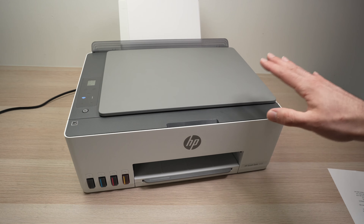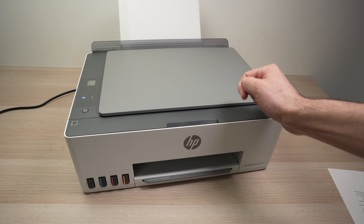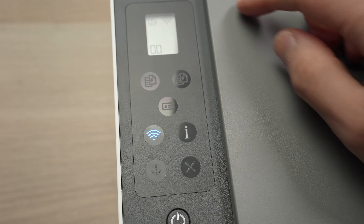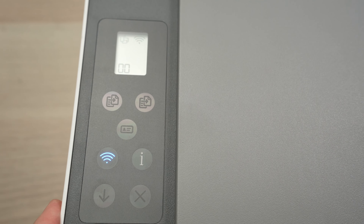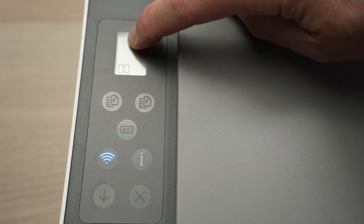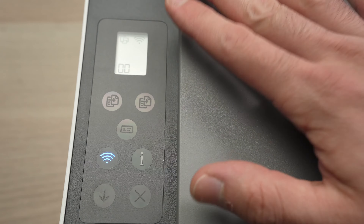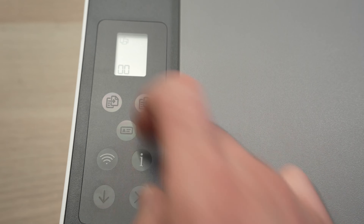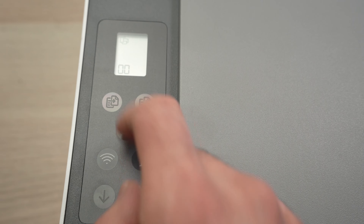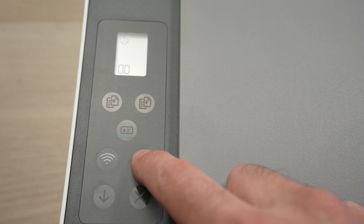You won't need any Wi-Fi router or Wi-Fi network to get this done. The first step is to turn on the Wi-Fi Direct feature of your printer on the control panel. Check the top corner: if you see an icon of a printer with a smartphone, Wi-Fi Direct is already on. If you do not see this icon, press the Wi-Fi button once, twice, or sometimes three times until it appears. Once it's there, press the 'i' button.